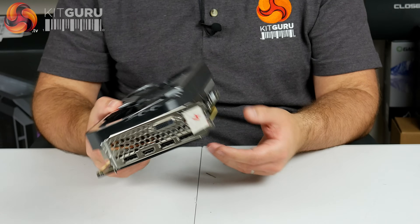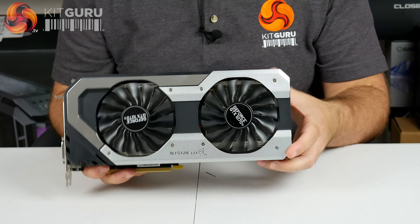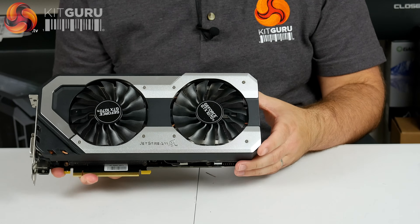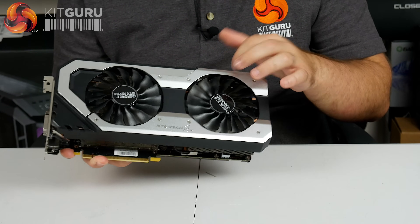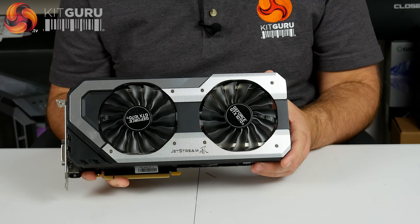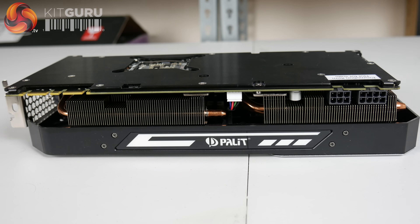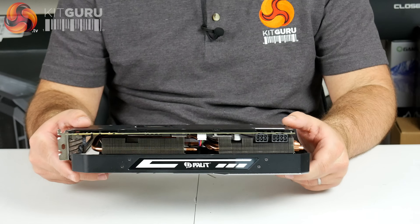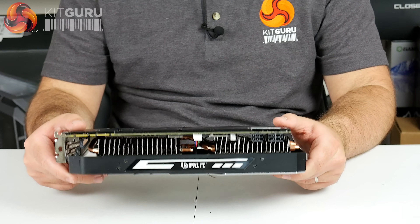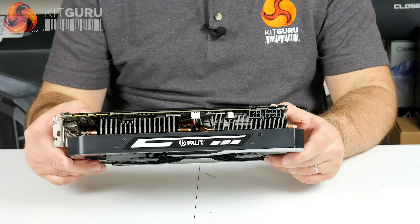So check your case compatibility. Flipping it back round, we've got these dual fans — they look like 100mm fans on the front. Silver finish, feels like plastic, and it looks good. It's got the Jetstream branding there. Flipping to the side, you've got the Palit logo and you can also see the power connectors — interestingly, this has got a 6-pin and an 8-pin, which for a custom-cooled card is interesting, because many 1070 and even some 1080 cards just had a single 8-pin. So the 6 and 8 pin potentially helps with overclocking and power delivery, but we'll have to see when we do the full review.